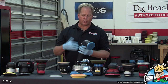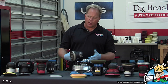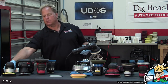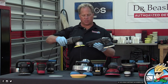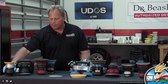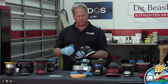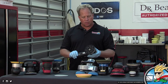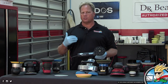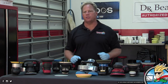These 12mm tools are really nice for thin panels, kind of like the Griot's G8. The Rupes Duetto — I really wanted to love this tool. I like the compact size and it's basically shaped like a Porter Cable, but it suffers from the same problem any free-spinning tool has: maintaining pad rotation. Down the road, just like the Bigfoot went through the Legacy, then the Mark II, now the Mark III, I hope to see an evolution in this tool.